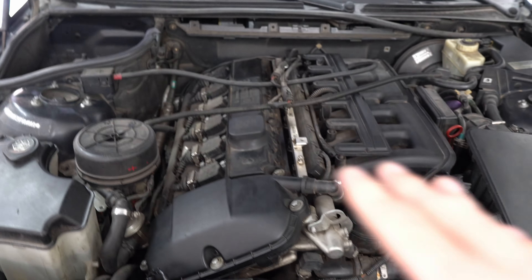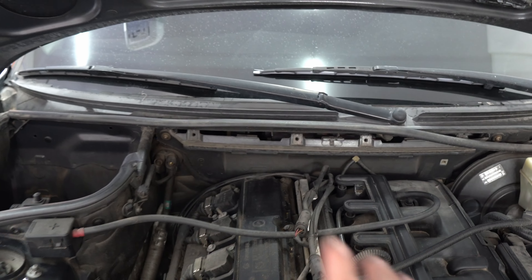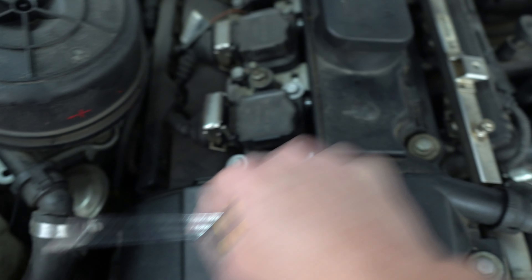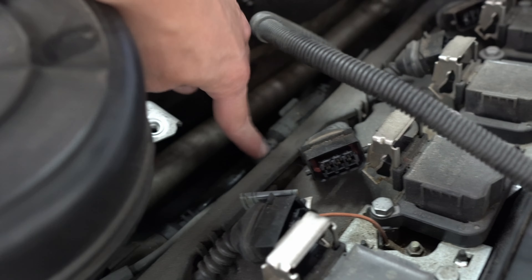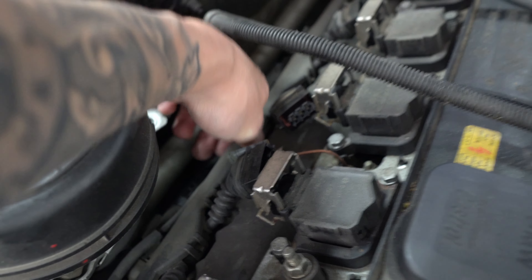Let's go ahead and start with the valve cover gasket. Just for safety, before you start working on anything up here, be sure to disconnect the battery in the trunk. Here's the engine bay — when I bought this vehicle it was missing the vanity covers on the engine, as well as the air filter housing up there. Next, I'm going to remove the spark plugs. To do that, grab a flathead screwdriver, kind of lift up and pull out the wire just like that, and do that all the way down. Anything in here that might be plastic will probably be very fragile and brittle, so be very careful that nothing breaks since the car is very old.